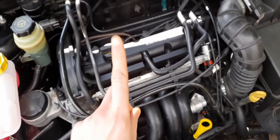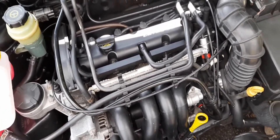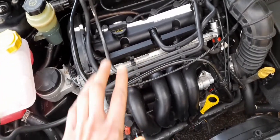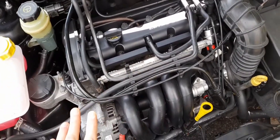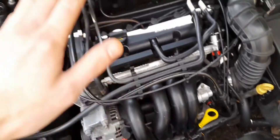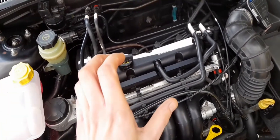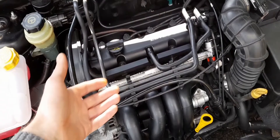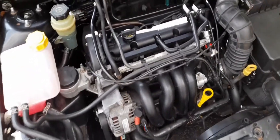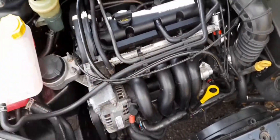Why? Very, very reliable engine. There is not much you need to do at all to this engine to keep it in fine fettle. The 1.8/2-litre engine - just for clarification - is a completely different engine with a cast-iron block, similar in terms of dual overhead camshafts, but a very different engine. It was more so made for Mondeos rather than Focuses, but was put on the Focus as a performance engine. The ST170 has the 2.0-litre on the Mark 1. Both engines are similar in terms of servicing, so a lot of what I'm going to say is interchangeable.